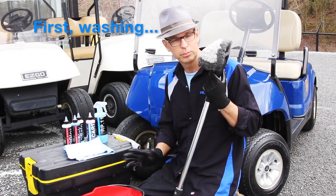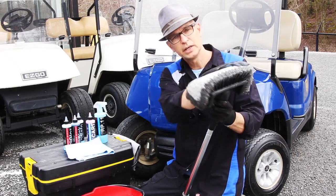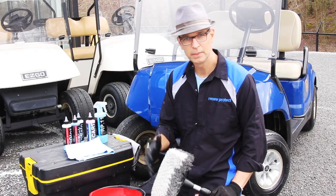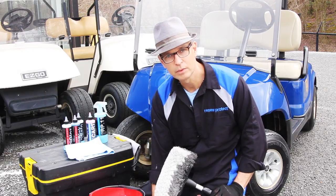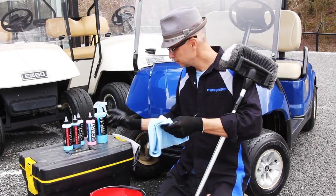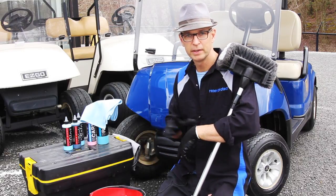For soap, I recommend a good brand car wash soap that has the correct pH balance for the job. My preferred way to wash is a soft bristle brush — it does not take much pressure, just medium to light pressure across the surface. When you dip in your bucket of soap, only go halfway so any loose particles or solids that may potentially scratch your surface sink down to the bottom. For drying and regular cleaning, use a spray detailer but only microfiber — always microfiber, no cotton or other blends. Microfiber towels or leather chamois for drying is fine.